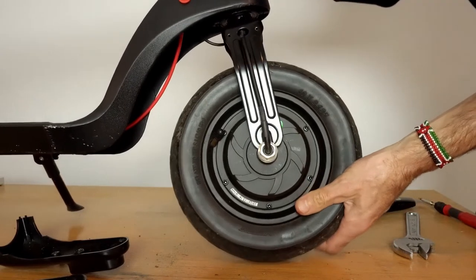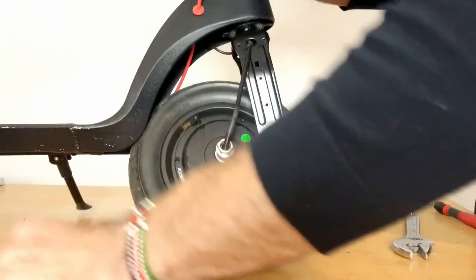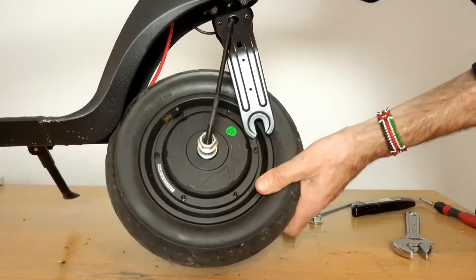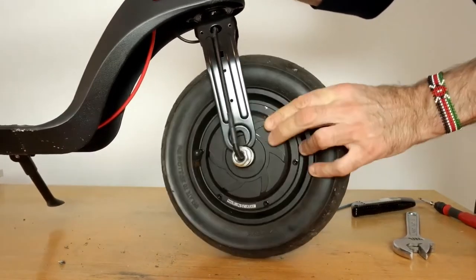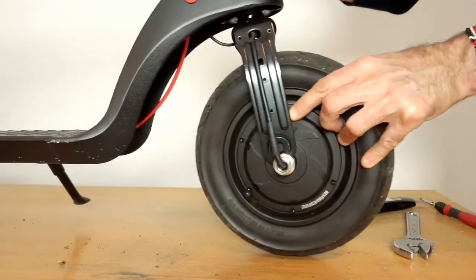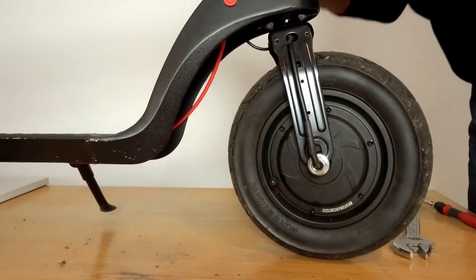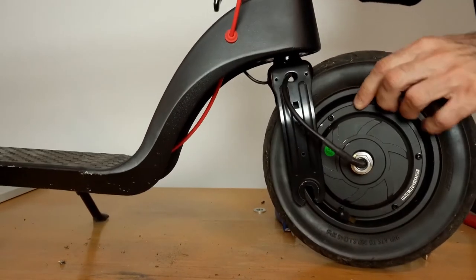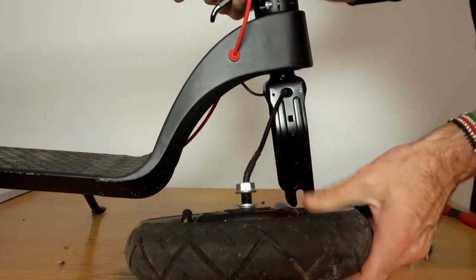Now, in this example, the motor is still attached to the controller, so this is what you need to do if you have a puncture and you just need to get access to the inner tube to replace the inner tube. If you need to actually replace the motor, then you'll also have to remove the controller from the scooter, which we'll cover in another video. If you need to know how to mend the puncture, then we've got a link to a video showing you how to replace the inner tube on the wheels. So we'll put a link below for that.